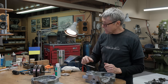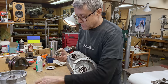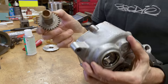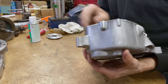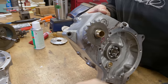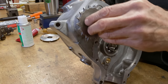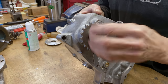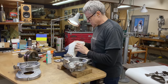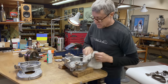I'm going to put in the sprocket and the gear right now. I got the seal in there, put a little bit of grease onto the sprocket. This seal — it's a tiny little seal but it should have a lot of stiction. There's no lock tab but you're supposed to punch it. The problem is you're punching onto a hardened shaft, so I'm just going to use red Loctite. It's handy having a couple of two-by-fours. This is the real start of assembly, so I want to make sure that everything is clean and oiled.